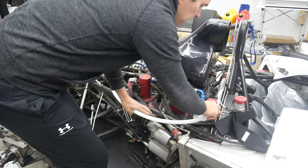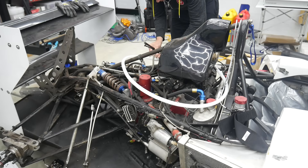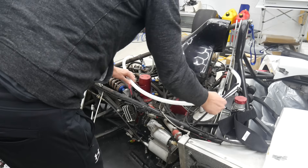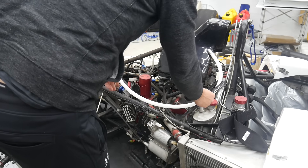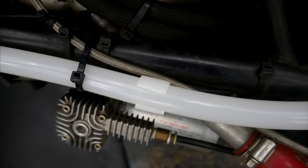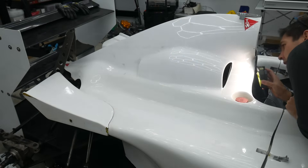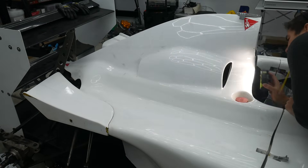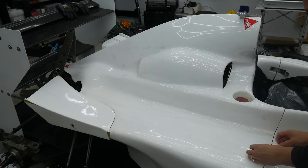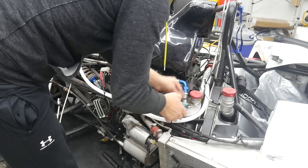There's not much you can really get wrong here. You have to respect the minimum bending radius of 16cm, and you don't want to place it too close to an exhaust or other really hot area so it doesn't prematurely go off. Beyond that, it's just a matter of using the supplied cable ties to hold it in place, ensuring you can still see the inspection gauge, and putting some sort of protection anywhere the tube has a chance of fouling and rubbing through. I could then reinstall the bodywork, conduct a visual inspection, tighten up the cable ties, and cut off the tails. Job done.